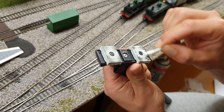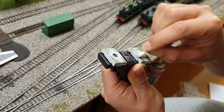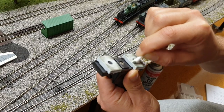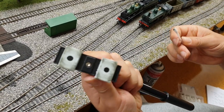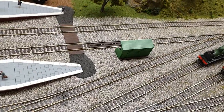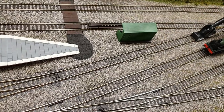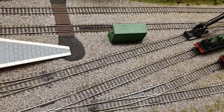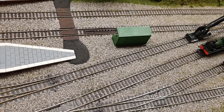It's great for the chrome on your car without scratching it, so therefore it's going to be great on your rails. The key thing is you don't really want to scratch the rails — the Woodland Scenics heavy duty abrasive pad will do just that — whereas this maintenance pad is ideal for only just taking off the bare minimum of what you want. You can see how that's cleaned up quite nicely. Now on the straight, it's super easy with this tool, and six years worth of neglect has all come off basically just like that.